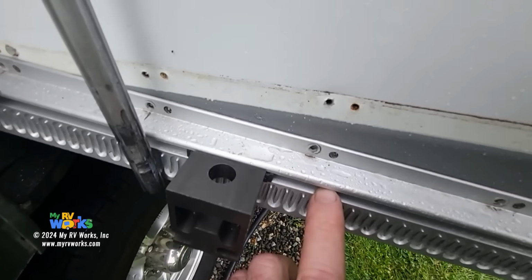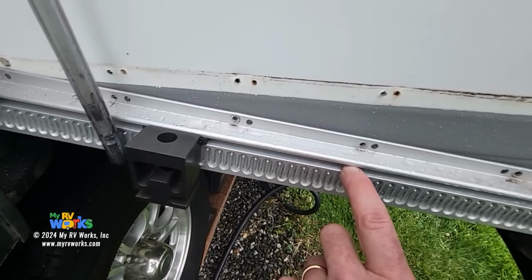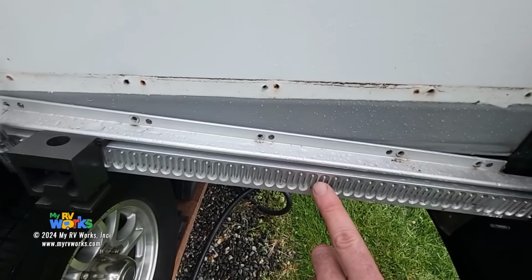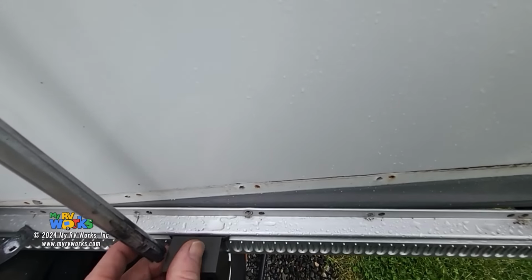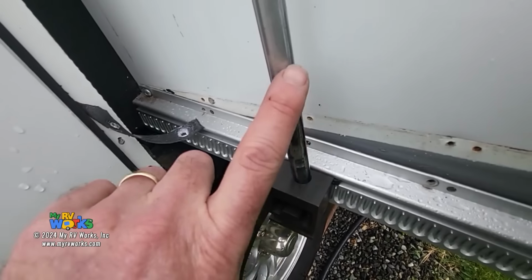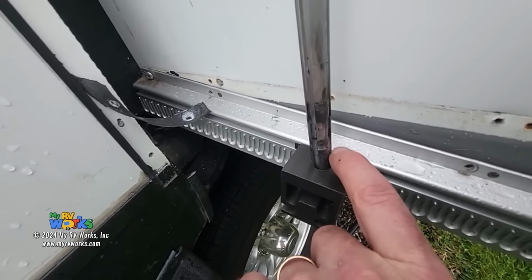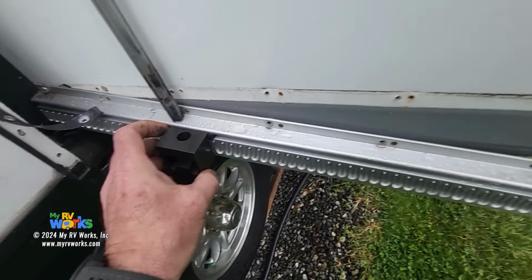So in other videos that I've shared, I said the most important place to lubricate is this track right here. You don't need to put any spray on the teeth. You need to put it in this track, okay? And then, I've got about 10 seconds before I got it moving in. I want you to reach inside your flapper seal, find this drive shaft, and squirt some right on the top of this so it wicks itself down. And then one more place. Okay, I gotta go. Yay!